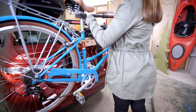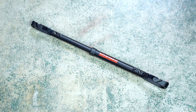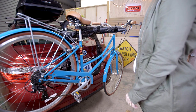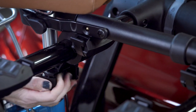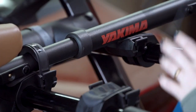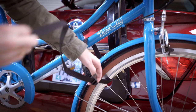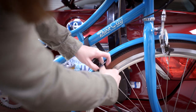The first bike always loads with the chain facing away from the vehicle. If your bike has a quirky frame geometry, you may need our tube top — it connects to the seat post and stem to create a faux top tube that will secure your bike. Loading a single bike? Use the innermost cradle. Rotate the anti-sway cradle against the seat tube, zip in the zip strips, and strap it.